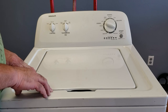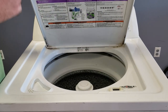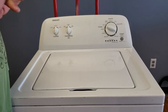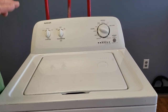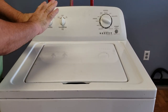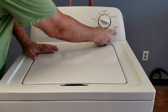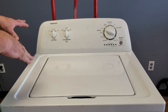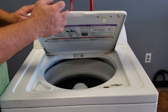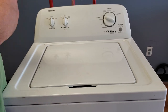The problem I had with this one: I plugged it in, water filled up, it agitated, and then it just stopped at wash. Nothing else moved. Now most of the time on these digital washers, when it's just locked up and you have water in the tub, you can hold down the cancel button for about three to five seconds and it'll drain the water out. This one, the water would not get out of the tub.